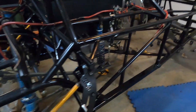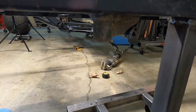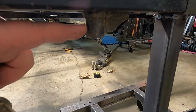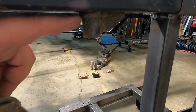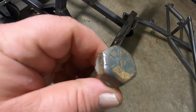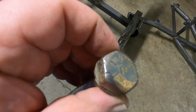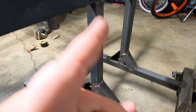We want to go ahead and put the front suspension back together, but we need to make one modification to our front cross member because this part is too long — or rather, this is just how they used to make it. Now they make this piece half as long. When you look at the head of the bolt we took off, you can see how polished it was in this area from where it's been rubbing up against the track. So we're going to cut it down a half an inch to bring this bolt up — that should help keep us out of the mud.